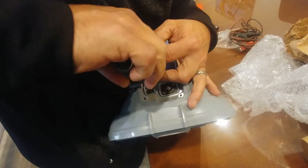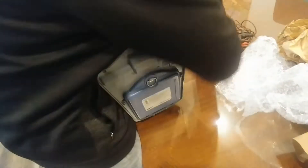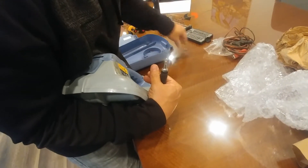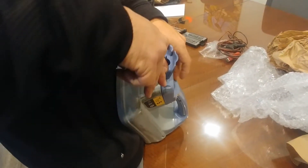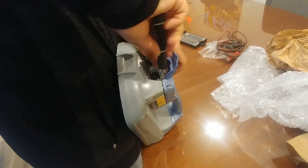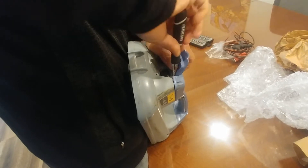You've got four on the top and four on the face. Make sure you're putting these screws in a safe area so they don't get lost because there are so many of them. A lot of times just use the tray itself — the circle that holds the extension cable — to throw all the screws in there. After you get those four out you can start on the bottom, but you have to remove the battery tray to get to all the screws on the bottom of the transmitter.